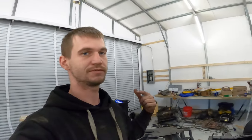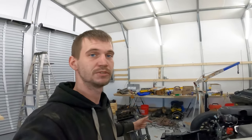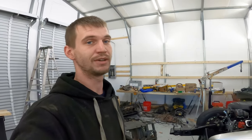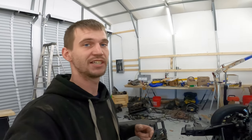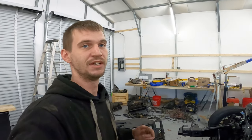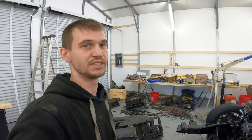let you guys know about, because racetracks don't allow you to run coolant. You can actually fill your radiator with that negative 32 degree washer fluid, that way it don't freeze in the winter and you still ain't running coolant, so the track don't cause issues with you if you start a leak, because they will kick you out if you leak coolant on the track. So that's a quick tip for you guys that might run the track a lot. You can put the negative 32 degree windshield washer fluid in there to stop it from freezing and still run the track without coolant and just straight water even in the winter time.